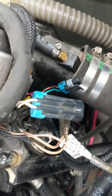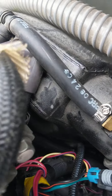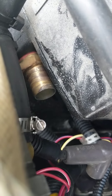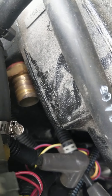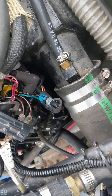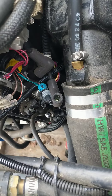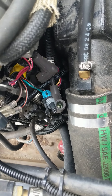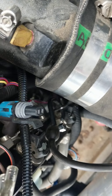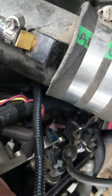To start off with, this hose here — you can't get to the plug without taking that off. It comes off right there. Tuck these back out of the way to work. Don't forget to put it back on or it'll pump water all over the place. My buddy said he'd work from the back and that did work well for the top number two. I can reach from here. Tucking those back out of the way — I'm just on the last plug at the bottom, that number six.